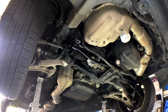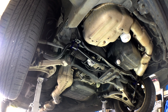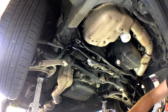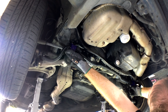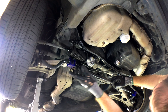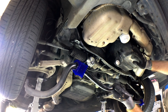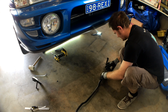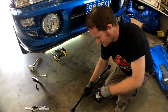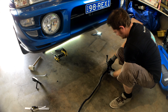So now I'm going to give it a real good scoring around where the edge of the bush sits. Now it's time to get that bar out. We've just got to unclip the brackets and the bar comes out. There it is. Now we feel lucky - our scribe marks will be here, which they are. Beautiful. So let's get these bushes off. So there's our bar out.